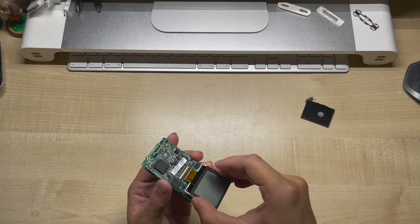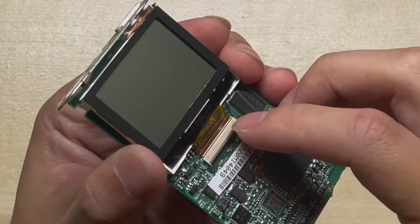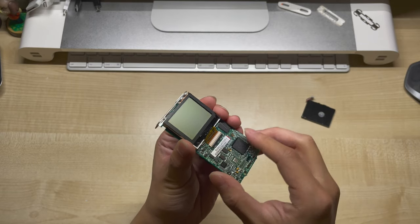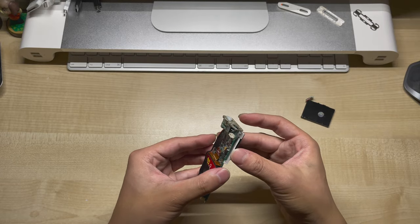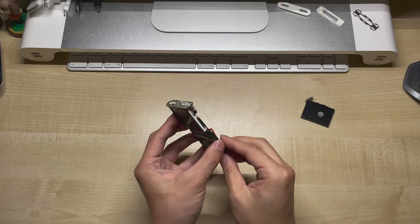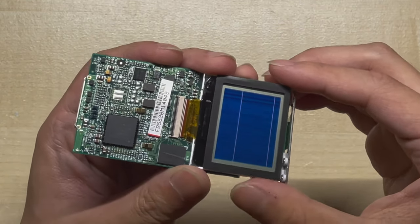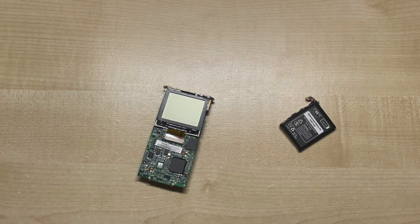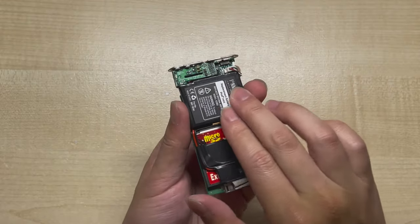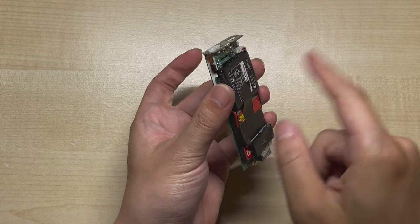Next we can reattach the screen. Just align the ribbon cable with the slot and push it firmly inwards. You can also use a fingernail just to grip it slightly and pull it. Make sure that the first white line is just below the connector and the second one is just outside. Then we can flip down the clip and that should secure the connection in place. Now all we need to do is clip on the four connectors on the side. And with that the screen is now in place. Sometimes when you reconnect the screen it might suddenly come on with all the pixels looking a bit crazy — that's normal, don't worry about it. Finally we can put the battery back — just push the connector in and slot it in. I'm also going to take a piece of tape and just hold it down so the battery doesn't flop around when I try to put it back into the casing.